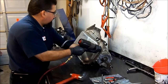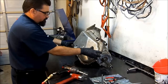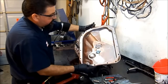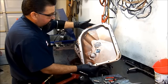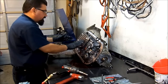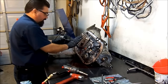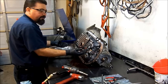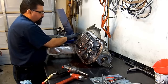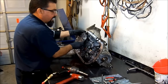We're going to remove the transmission pan and see what it looks like. The pan looks in very, very good condition. What I'm assuming is that they serviced this transmission thinking it might fix it. The filter looks fairly clean — it looks new. On used filters, the shiny metal will be a little bit black; that's normal because transmission fluid is made of carbon molecules and that carbon film gets on the filter. This one has very little carbon, which indicates it's a brand new filter.